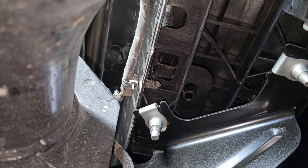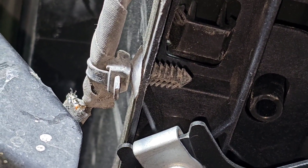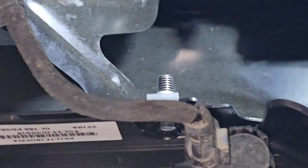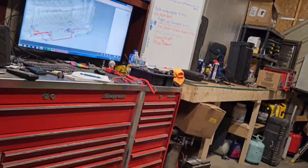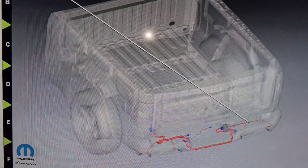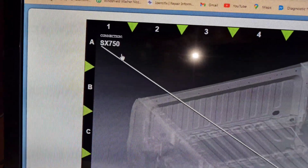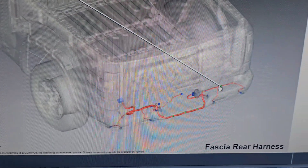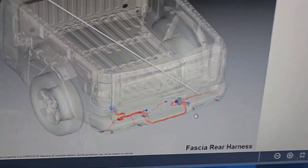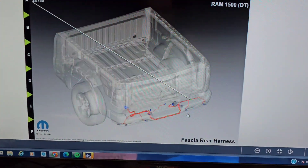Look what I found — it's open right there. It's supposed to be a splice between this sensor and this sensor. That splice is SX750 and it's open. That's why there's no ground to any of them. I'm going to repair it and see if that'll fix it.